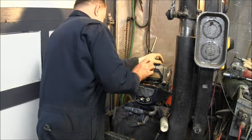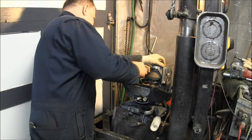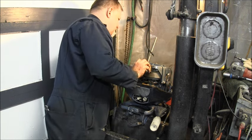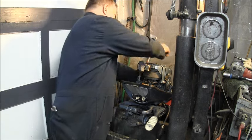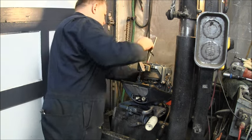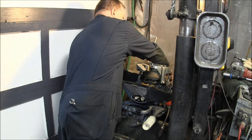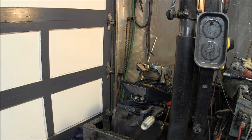Okay. It sure looked like it's firing good to me. But... Well, it sure don't... See if it seems a little weak that time. They look like they're both firing, but I'm gonna get another one. These are J6Js. I'm gonna find one and try another one.